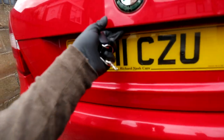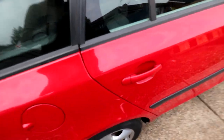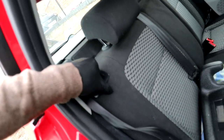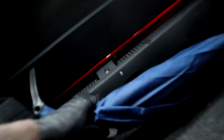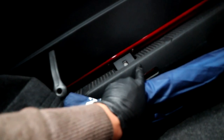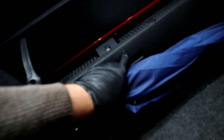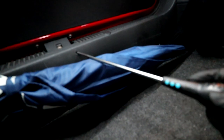You may think to yourself: how am I going to get in the boot to change the part if I can't open it? Well, on these cars, if you unlock the car, go in the back, and bring the back seat down, you can access the boot from inside. Right here is the latch that's supposed to open, and next to it there's a tiny hole - if you stick a screwdriver in there, there's a manual latch to open it from the inside, just in case something like this happens. I'm going to grab a screwdriver and open this up.